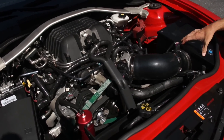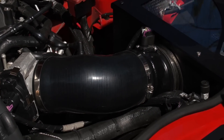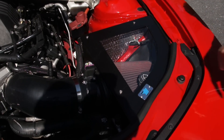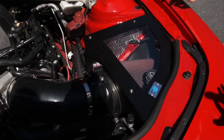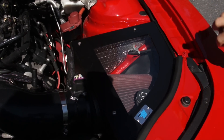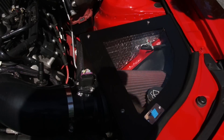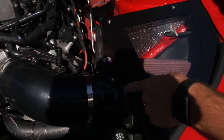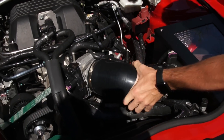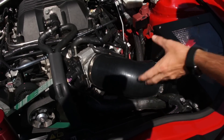The first thing I did to this car was a cold air intake, and I installed this myself. It's by Cold Air Inductions and it has an insulated air box with a lid that comes off so you can refill the windshield washer fluid and clean the cone filter. It has a velocity stacked mass airflow sensor section, and it's made of a PVC rubber material so it doesn't get as hot as a metal intake would.